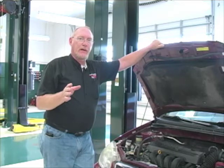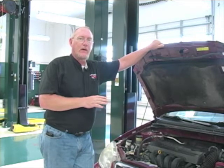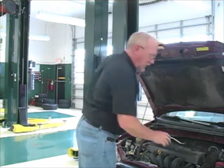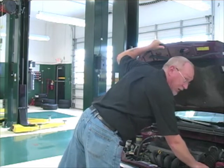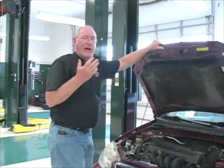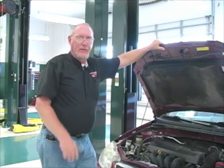So we're going to test the system annually, and the first thing we want to do is make sure that we can access the system without getting hurt. Make sure that it's safe to open, it's not under pressure, it's not too hot. What I like to do is grab a hold of the upper radiator hose, give it a little squeeze, make sure I can put my hand on it and hold it there. And then if I can squeeze it all the way shut just with my hand, then it's a pretty good bet that there's no pressure on the system and I'm safe to open up the cap.